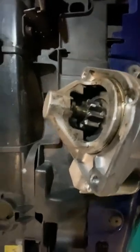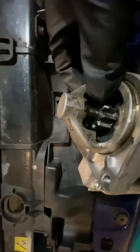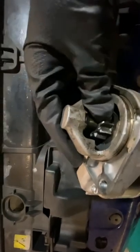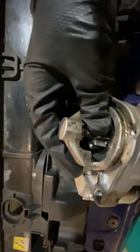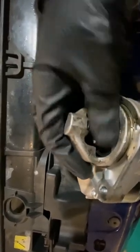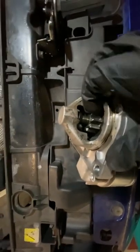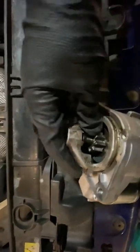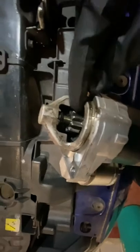The way to check it is to count how many teeth your original one has. If we start there, you can just ever so gently turn it like that — just keep turning it. As soon as you get back to your mark you'll know how many it has. You can bring it all the way back to your mark without a problem, and there's our mark — this one's got nine.